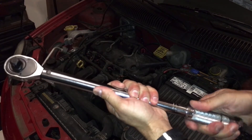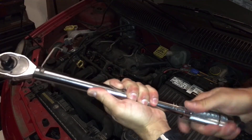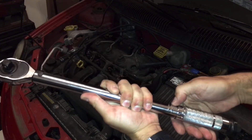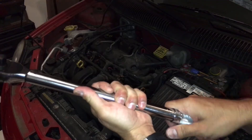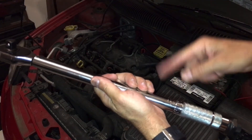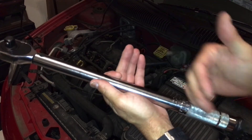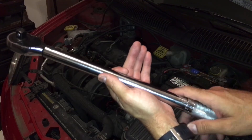We're going to take it all the way up and then back three times, and then we'll be ready to set the torque for the spark plugs and put them in properly. If you want to see more in-depth what I'm doing and how to use a torque wrench, you can do that via the link in the description and the link shown above.